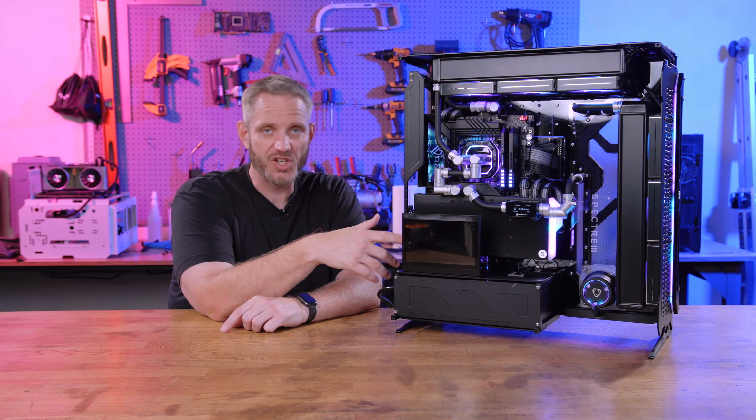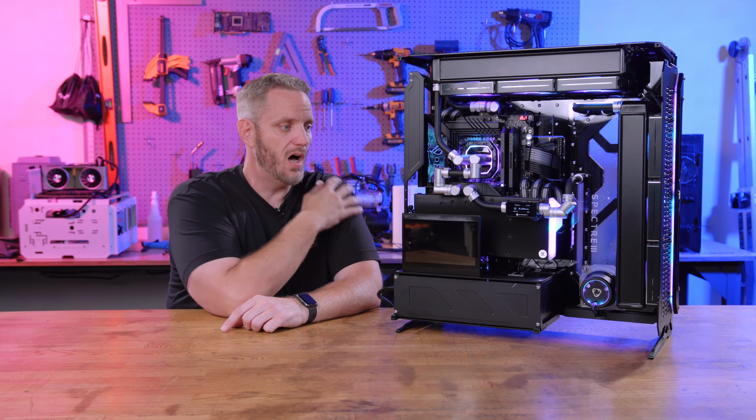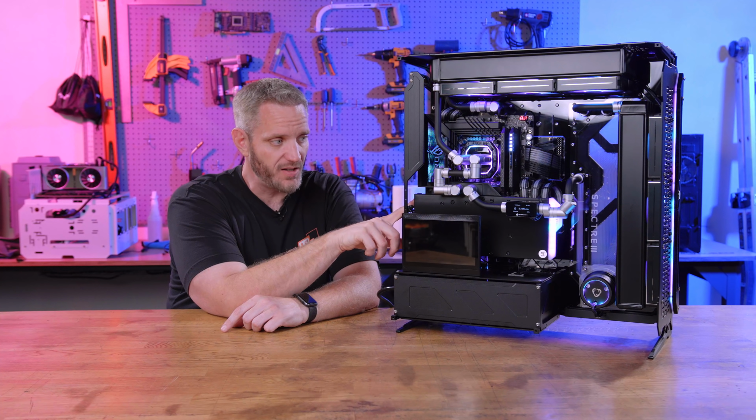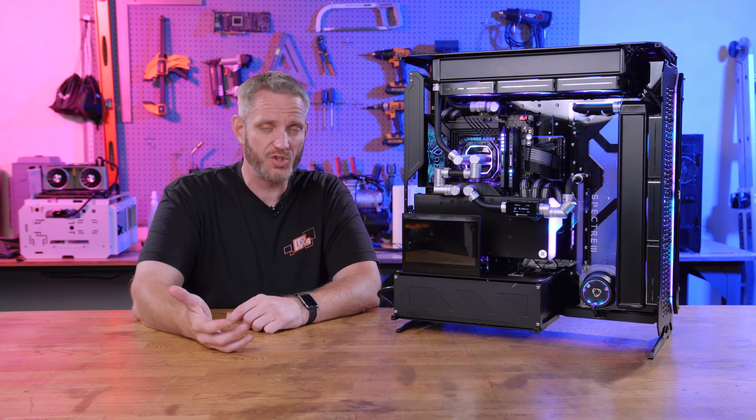Now that it's water cooled, I should be able to maintain clocks nicer. The system is gonna be quieter overall. I've already had this particular card in a gaming rig on this block, so I know that it doesn't coil whine like a monster. That's another thing, you never know whether or not you're gonna have a card with coil whine once you put a block on it.